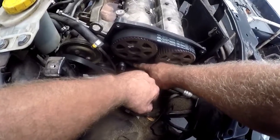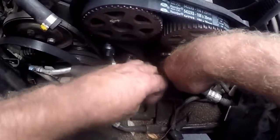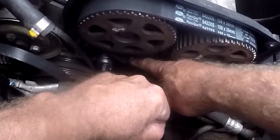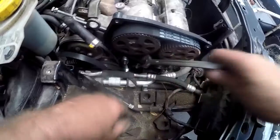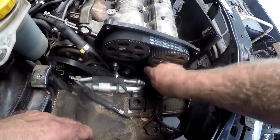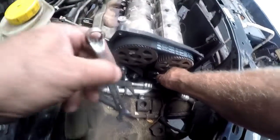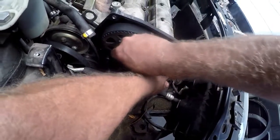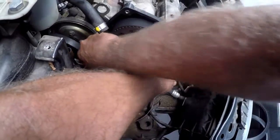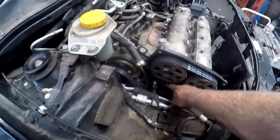Watch the belt — you'll see the tension on the belt as I push my finger on it, and as I adjust the tensioner you'll see the tension go off the belt. You're basically using a size-17 spanner against the tool. Pull it, take all the tension up, make the belt pretty tight, and while the tension's up, lock the tensioner. Take the spanner off your tool and now the tensioner is basically locked up — very tight. The setting is not right yet; we just have to check everything and make sure our timing marks are still lined up.